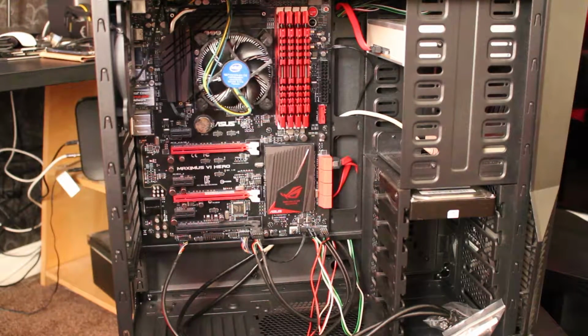Now another used part which I am going to put in, I'm going to shove in one of my GTX 980 Strix graphics cards. Even though my second one was bought in January, I am really tempted to get a GTX 1080, simply for going down to a single card. It will give me the same performance as what I'm getting now, and it will lower temperatures a lot from the SLI that I've got currently. But as you can imagine, that's for a different video.